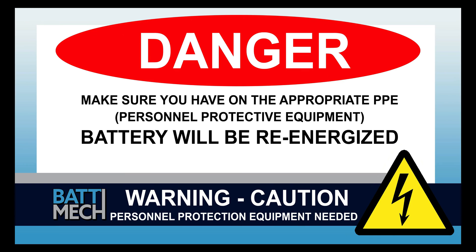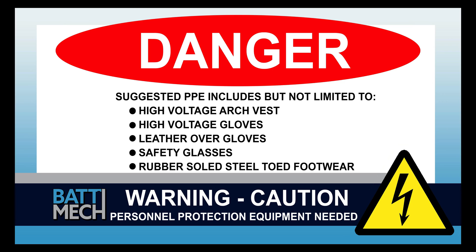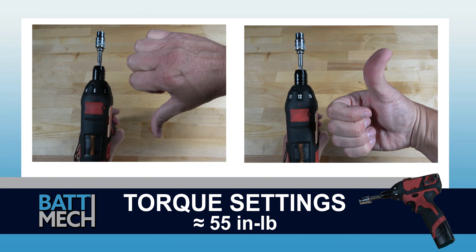The rest of the reassembly of the battery pack will re-energize the battery. Your shop may have different protocols to keep you safe — it's always best to follow your shop safety protocol. Before attaching the wire harness, be sure your torque settings on your torque wrench are set to about 55 inch-pounds. If you don't follow these torque settings, you are likely to damage the terminals on the modules and will void your warranty. Never use max drill settings and never use an impact wrench.